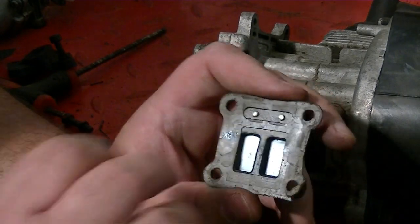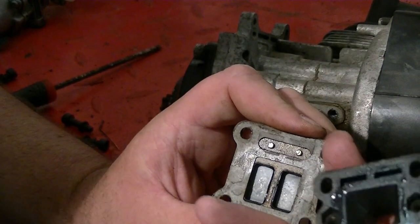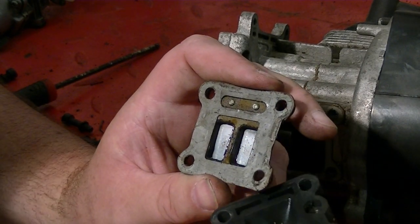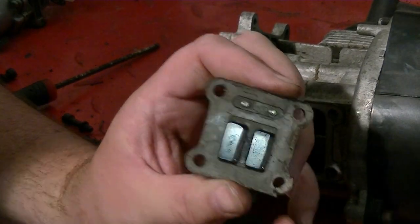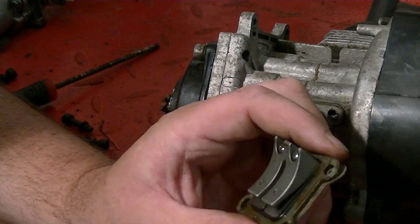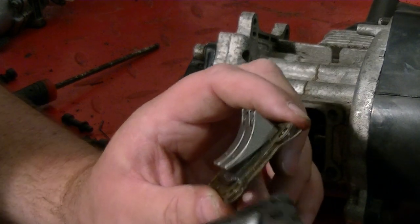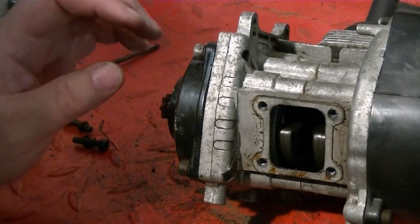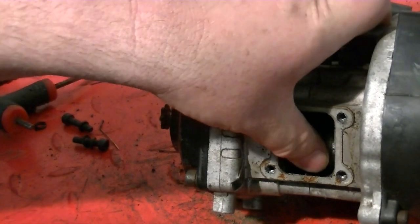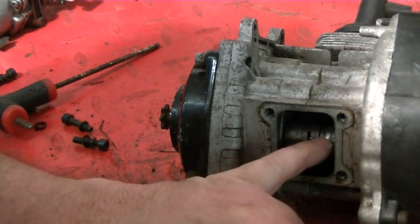This plastic manifold on this engine is quite restricted. You can remove that inner piece as long as you've got a solid reed behind it — but if you left gaps between the reeds it wouldn't run. A common sign that the reeds are wearing out or not sealing is that the engine starts spitting petrol back out of the carb.